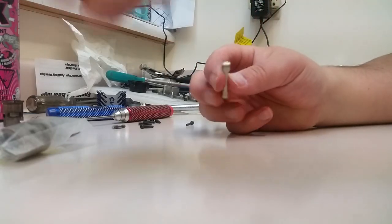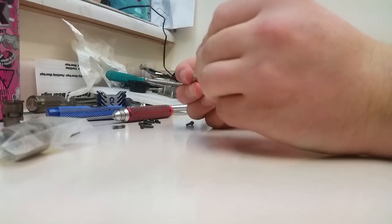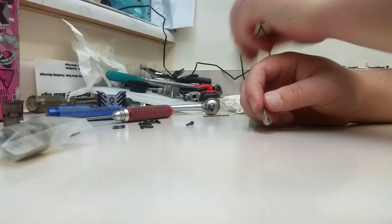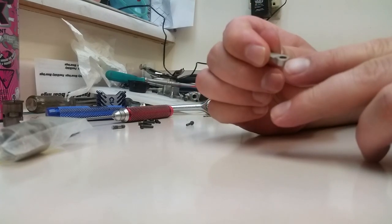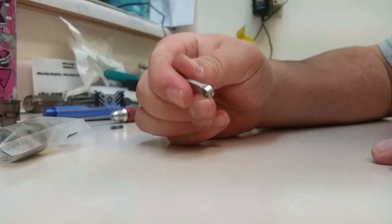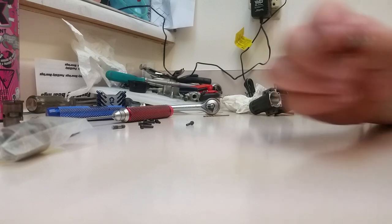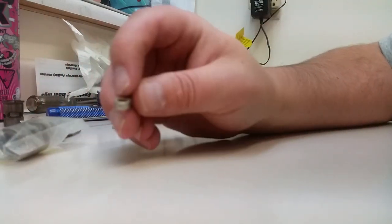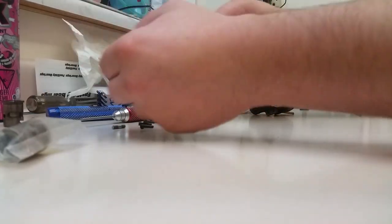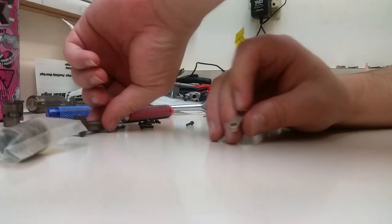Next, we're going to take a pin, and you want to verify that the oil holes are both clear, that there's no stuff in them. Should be able to see it right through like that. So we know that's good. And if you're concerned about what way the rod went back in, remember there's that scratch you put on there. It's hard to see in the lighting here, it's terrible. Anyway, there's a tiny scratch there, but if you're really concerned about it, if you look at the bottom of the connecting rod, the big end, there's a chamfer there. And the chamfer always points towards the crankshaft, like this. So the chamfer side will go on here first.